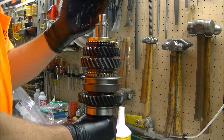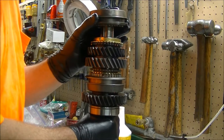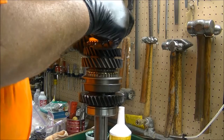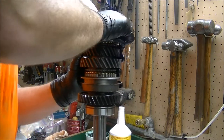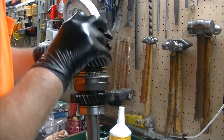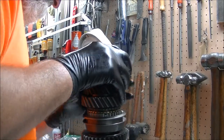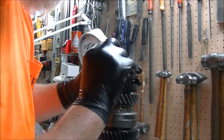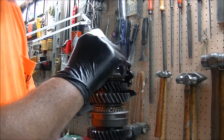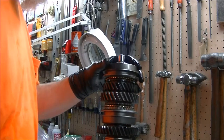We put on the synchronizer assembly, and the tapered portion right here goes towards the front. And make sure you line up the shifter plates with the locking ring. There. Now, we've got another C-clip. Goes up right in here, and I've chosen two of them. One's 87 thousandths and one's a little more than that. You need some clearance. How much? 10 to 15 thousandths clearance.